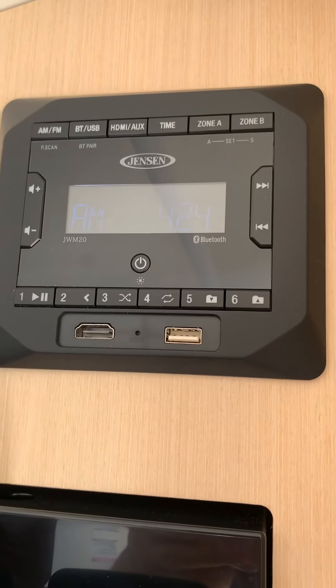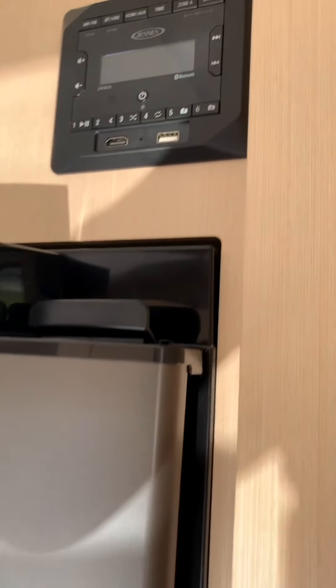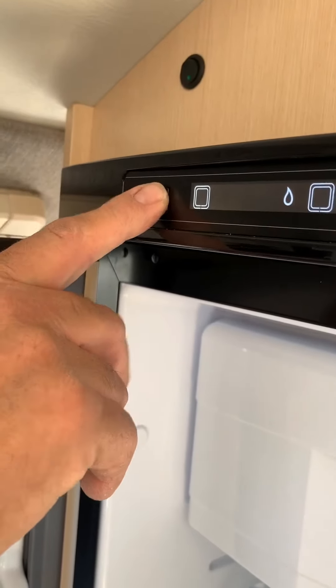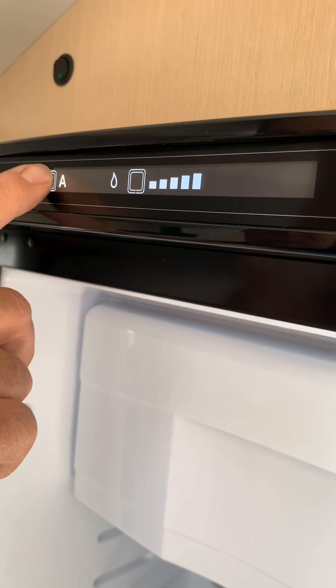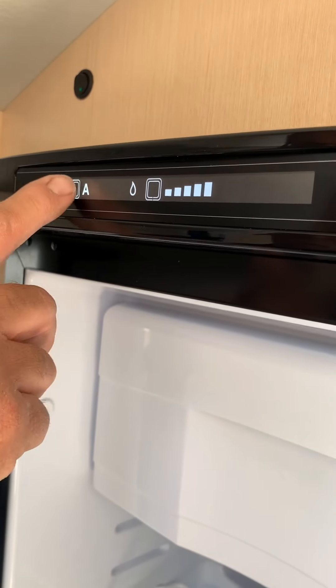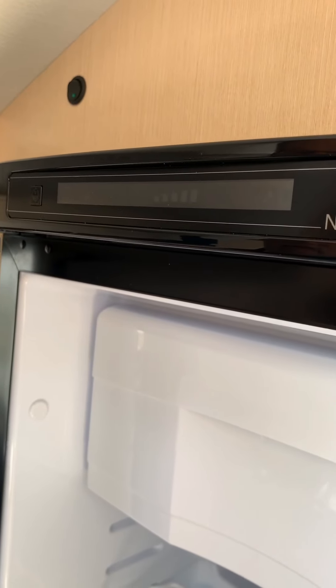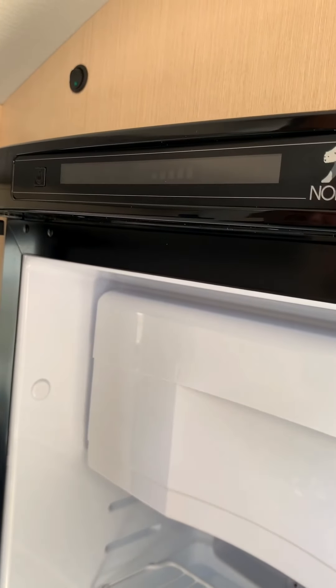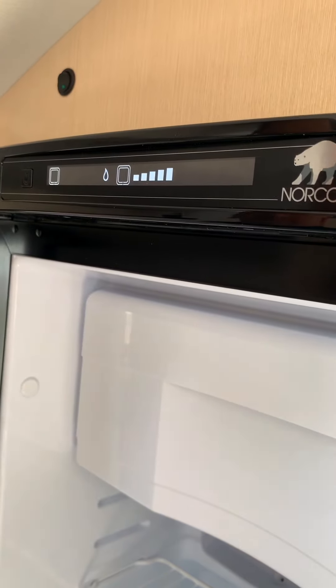On the stereo, it has zones listed — front and rear zones — so if you want to listen to music up there while somebody's sleeping, you don't have to disrupt them. Here's your refrigerator. You have to open the travel lock here — this latches the top, and the travel lock latches the bottom. Here are the controls. It's on gas right now. Automatic mode goes: gas, 110, then 12-volt. Or you can change it to 110 — we're not plugged in so it's flashing. Or you can go to battery. We go back to gas — we're all set.